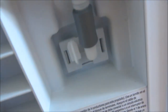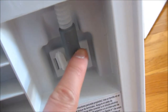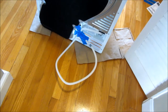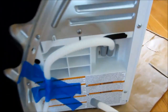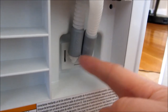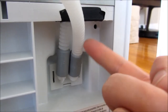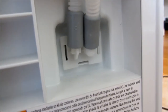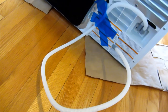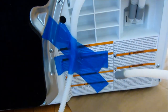The way the drain works is in the back here. Normally it drains down to a bucket in the bottom, so I'll be putting this right there, and then I'll put the hose in place of this at the top and drain it out. You'll notice I got the hose attached right there. This empty hook is just a placeholder for the extra hose — it connects to nothing. This is where the actual hose will pump out water upwards. The hose that comes with it is about three feet, which sounds long but is actually very short when curled up. I also taped it just to give it some slack and keep it in place.